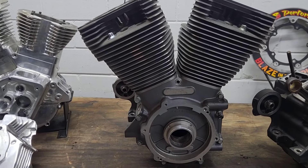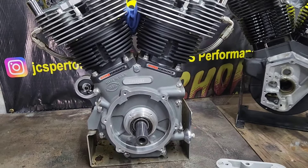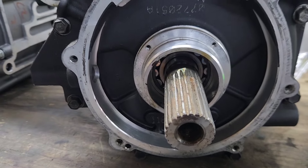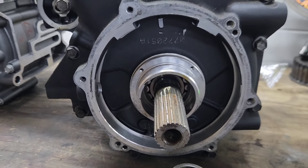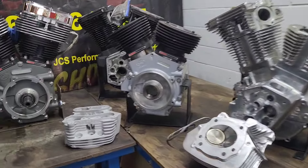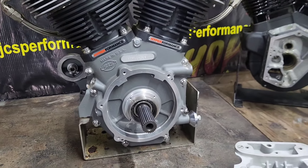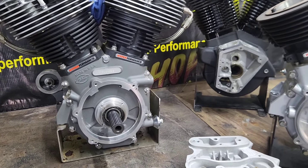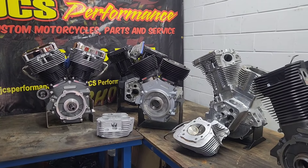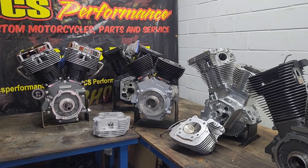In my opinion, if you're not going to be running high RPMs and drag racing, I strongly believe these roller bearings will hold up to 150–160 horsepower — I see no problem with it. Once you start getting into higher horsepower and putting a lot of stress on the motor, I strongly believe a Timken bearing is the way to go. These are just my thoughts and opinions — I'm not saying one is better or worse. I hope this helps you guys out. Feel free to call or message us, and thanks for watching — we'll have a lot more cool videos coming soon.